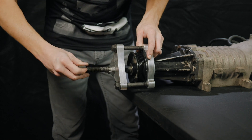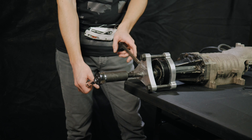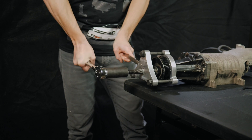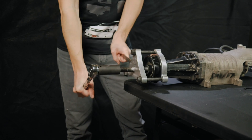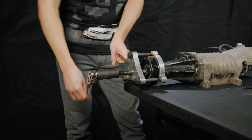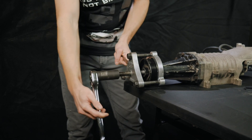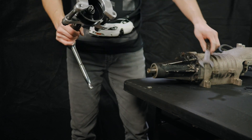Start to tighten down by hand. Once you've got that all on and lined up it will be quite difficult, especially if you've never removed it before. But basically you're just going to wrench it off. Now if you hear any loud pops during that, it's normal — that's probably just it unseating itself, and then it'll get easy. Just work the hub or the pulley off the hub, and there you are — the stock pulley is now removed.